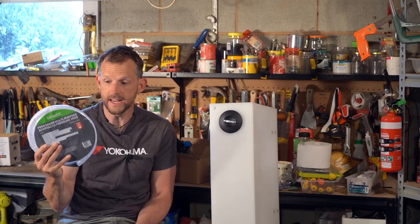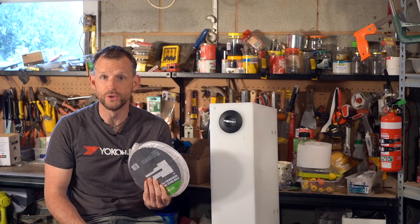And so the final consideration for this whole system is how am I going to get water out of and into the tank? And out of is really the easiest one to think about. I've got some food grade hose here. This is just 1/2 inch diameter plastic hose, but make sure again that it's food safe because you are going to be drinking this water. And so I just run a hose from the tank to the pump directly. Then I'll go from the pump through the filter.